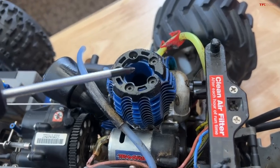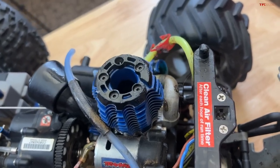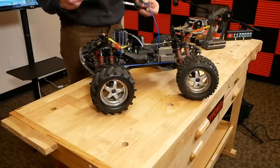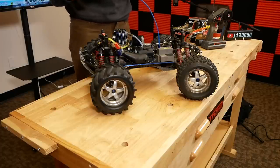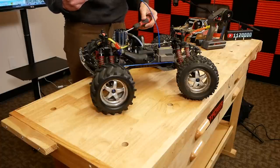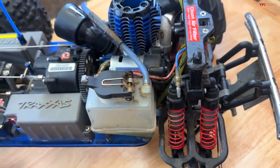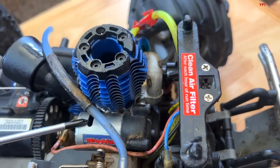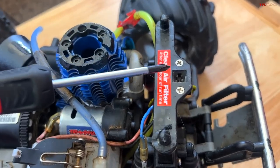So you've got a glow plug to start the ignition process, but once the little motor fires, it actually runs on compression and heat, kind of like a diesel engine. And it's a two-stroke design, so there's no integrated oil sump, it's actually oiled by the fuel itself. Now these Traxxas units have an electric start, which is operated via a starting handle which you insert here.